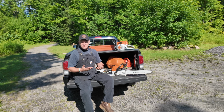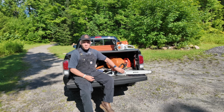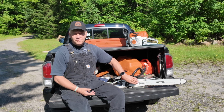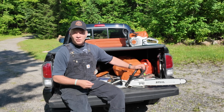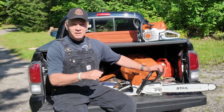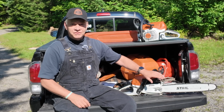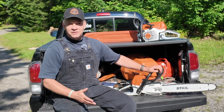And I think probably a lot of you folks that have had some experience with it, and probably far more than me, know that if you keep that saw dirty for a few days, more and more debris, chips, what I'd almost refer to as kind of gunk because it's mixed with oil, slowly packs up inside the casing around your sprocket, and you start to find that you're plugging that channel for oil. And I think that's when you're going to start finding your bar is overheating or you're not getting enough oil to the bar. Because whether you see it visibly or not, when you run out of gas and you open up your oil reservoir and that reservoir is only halfway empty or 3/4 of the way full, you know you've got a problem. So if you start the day off right with a coffee, clean that saw out, sharpen your chain, clean out the channel in the bar, make sure the oil passage or channel is free, you have a much better day out in the forest.